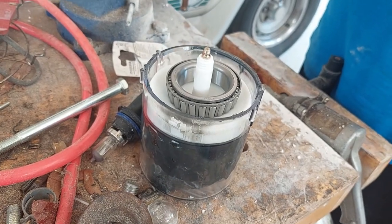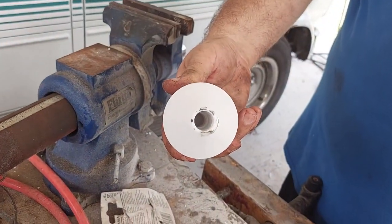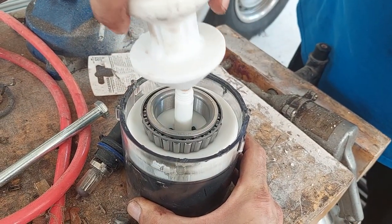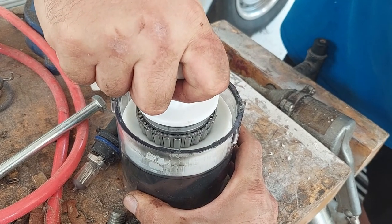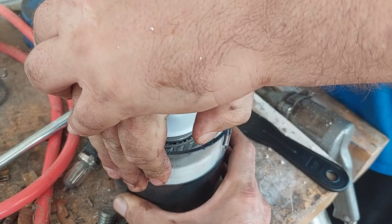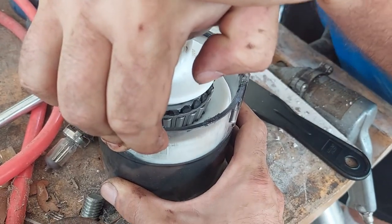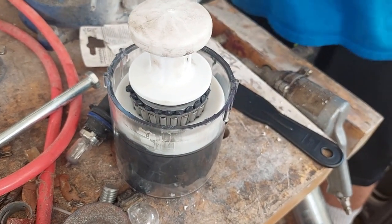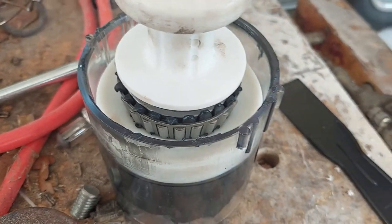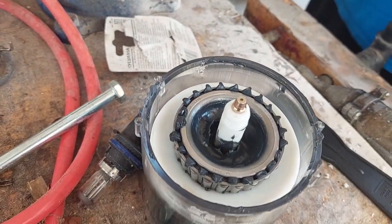To use this tool, it's pretty straightforward. You're going to put the bearing narrow side down, and then it has a handle slash plunger that you screw in place on top. Once you've got the bearing pretty much centered, you start to push, and what it's going to do is force grease through the bearing. When you see grease coming out the top, you're good to go - just like that. I can tell you from the silent struggles of my brother, you've got to push pretty hard. But when you see grease coming out the top, you're good to go and the bearing is ready. That is a significantly less messy way of doing this than doing it by hand.